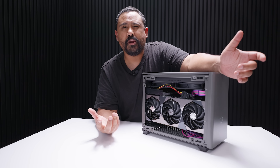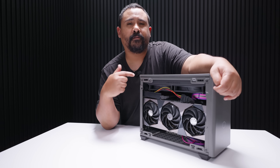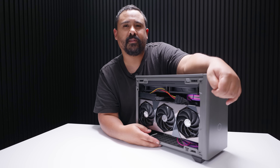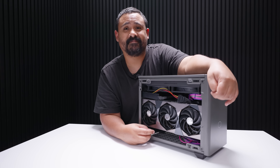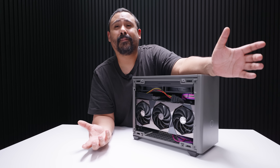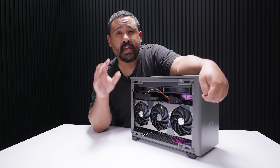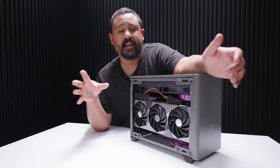What I think might be happening is because this is a B760 board, not enough PCIe lanes are being utilized. For the back M.2 drive we've got 4 lanes, for this card we've got 4 lanes, and then 16 lanes for the GPU - that's 24 lanes total, which is probably as much as this platform handles. It's probably only running at PCIe x2 which is why we're getting that problem. B760 only has 4 PCIe Gen 3 lanes in total compared to B660 which had more - they reduced Gen 3 lanes and increased Gen 4 lanes.